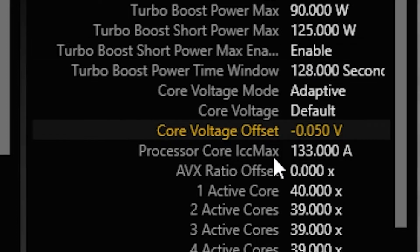What you can control though is voltage. Typically, CPUs run in a range between sub one volt to about 1.5 volts at the extreme. The higher the voltage, the higher the frequencies a CPU can sustain, but the hotter it will be and the more power it will consume. That's a massive oversimplification, but that's essentially what's going on. You want to keep voltages as low as possible while still being high enough to maintain stability. But you might notice that we didn't specify a core voltage — we specified an offset, and that difference is very important.